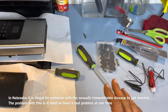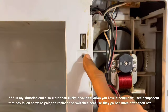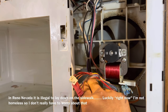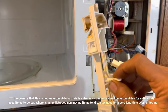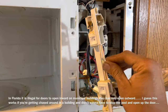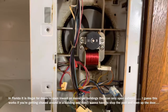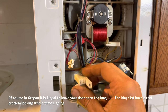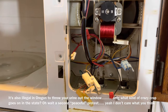This leads me to why this fuse blew — obviously there's something else going on. You can see the switches on here. We need to remove the Torx bits that hold down our switch control. Once you've taken the Torx bits out for the door latch, raise it up and move it over to pull it out. Most of the time the things that go defective are things that are heavily used, like buttons or the door opening and closing. It's crazy to think that the door opening and closing was the actual problem with this unit. Just snap a little picture of the connectors on there so you can put it back correctly.